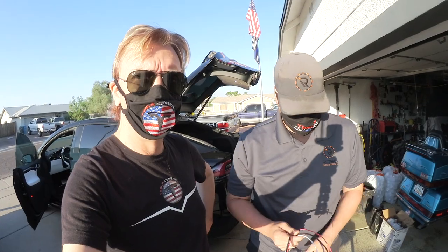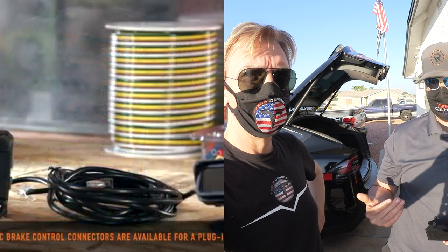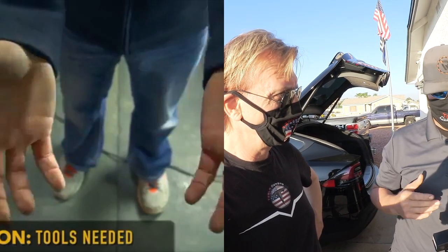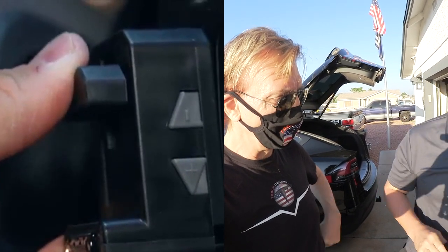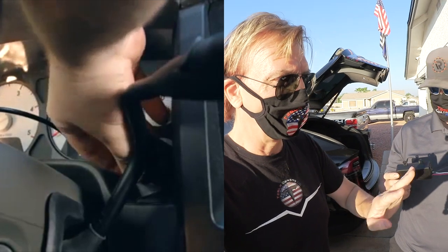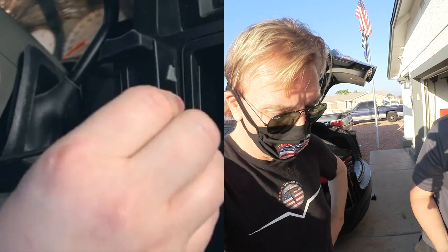The other pieces include our control box. For this car we went with the Hopkins Insight system — I actually really like it, I used it on an old expedition of mine. It's proportional, so it uses the inertia from the car to apply a certain amount of braking power to the trailer. If you brake hard and the car has resistance, it brakes hard and applies more power to the trailer brakes instead of less. So that's the control box.